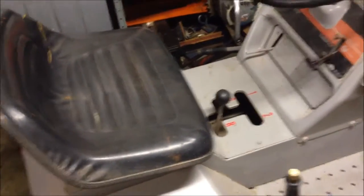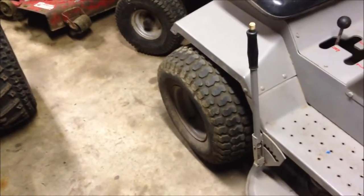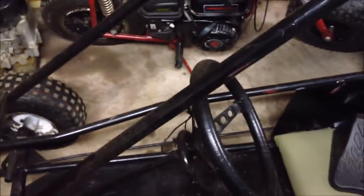But anyway, I brought this one in because I was mowing with it last week, so it's going to have to go back out to the other shed now that I'm not going to be using it. I just had to charge the battery back up on it. I did have to take this one apart and clean the carb again to get it to run perfectly like it was before I put it up. So I'm going to run some Seafoam through it and let the gas hopefully run through it and run out of it, and see if it'll stabilize the gas long enough I can keep it stored for a while. But that's where we're at on that.